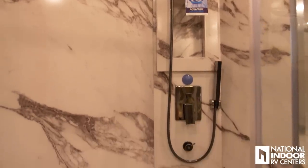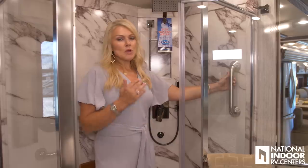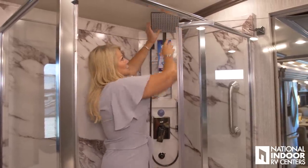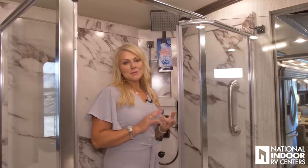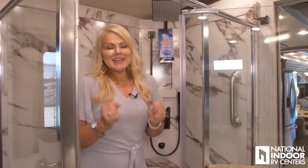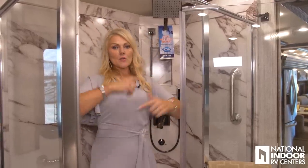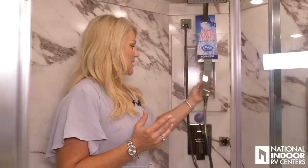One of the great features of the 4369 is this huge shower — 50 by 34, bigger than my shower at home. You have so much space and there's a little shower assist bar — a safety feature we always put in. There's a great adjustable rain head shower faucet, and this little blue button is your shower miser, which comes standard in the Dutch Star. You turn the switch and water cycles through until it's warm — when this lights up, you turn the knob and you have hot water. It saves water if you're not connected to city water, and it won't fill your gray tank unnecessarily. There's also a wand — a nice little feature in any shower.